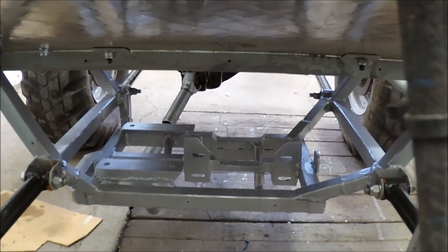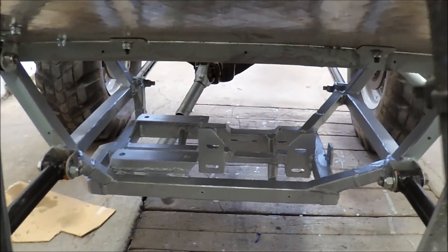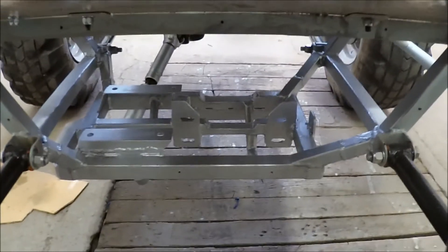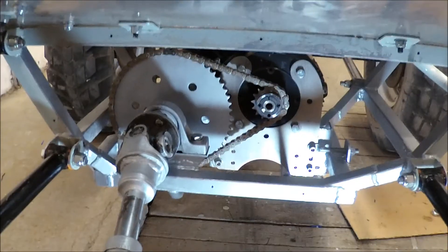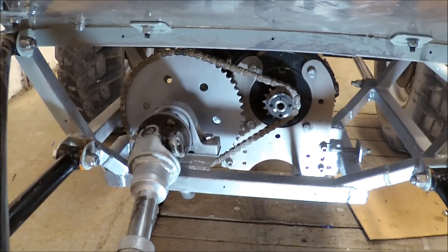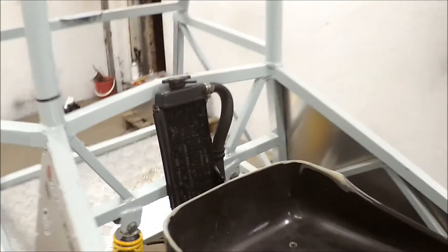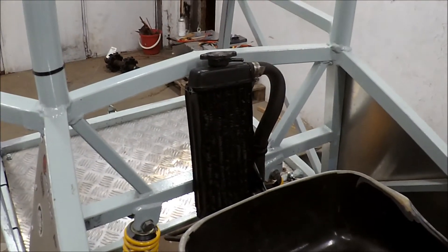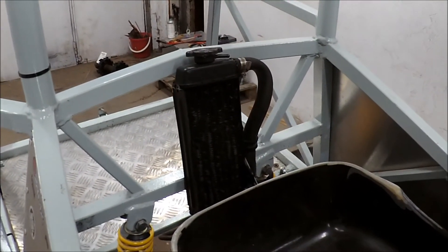I managed to get it in place — it's painted and ready to get the other stuff put on. Now the motor and the new gearing is in place. This is the water-cooled motor, so I also fitted this small radiator, which is from a dirt bike. I'm betting on siphon circulation — I have no electric pump or anything like that, so I hope it's gonna work. Here you can see the hoses and the transmission.